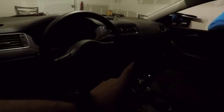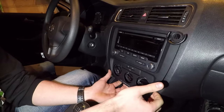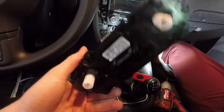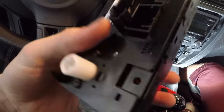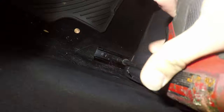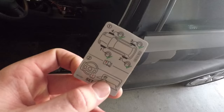Today we're going to try to install the switches in the dash. We took the dash apart but unfortunately this is a full cluster piece and inside there's a logic board behind the grate, so you can't drill through it and install the switches there. Volkswagen already has factory heated seat sticker locations, so we'll take care of placing those properly.